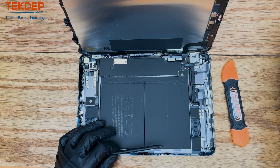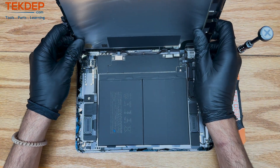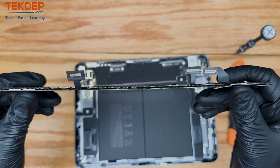And then also that screw that holds on the faceplate for the battery connection. You're going to want to disconnect that battery. Those three flex cables are for the LCD, the digitizer, and the daughter board. And there we have the screen — and those are the flex cables.